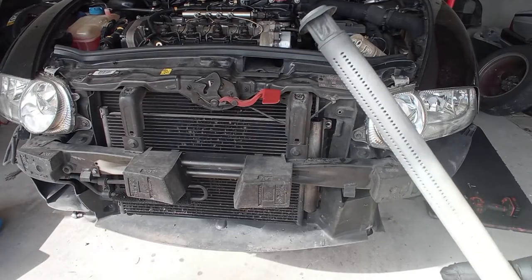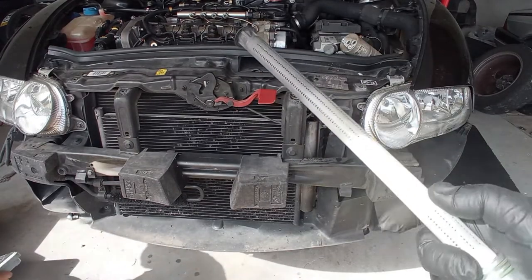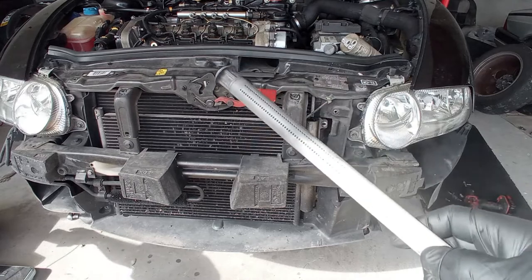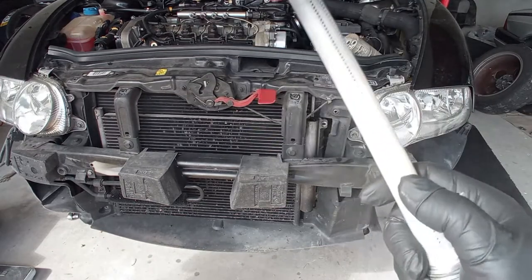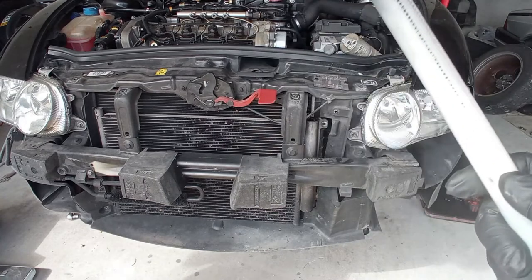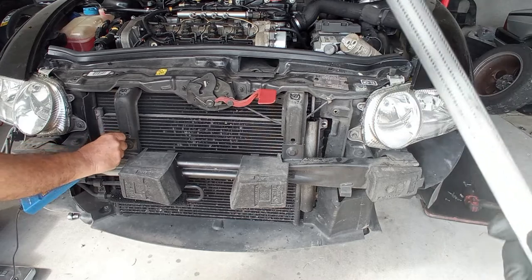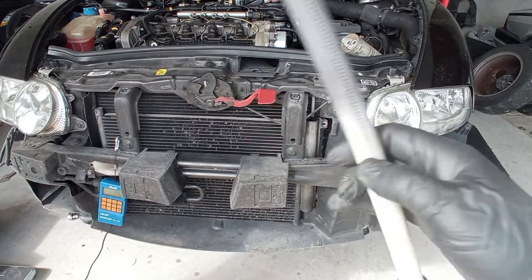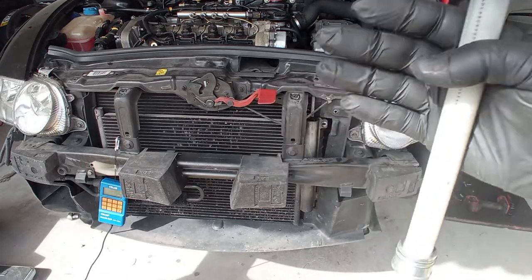Sometimes this happens as you charge your AC system. Sometimes hours later or days later or weeks later, it no longer works. And yes, we have the correct amount of freon. Yes, you have the clutch engaging, but you do not have any pressure, like you saw here in the video. What is happening now? We must see if we have a problem on the compressor itself, if it failed by itself or something made it fail.